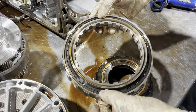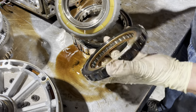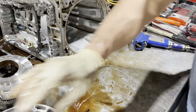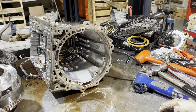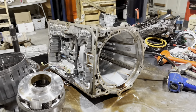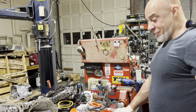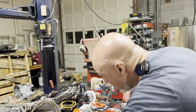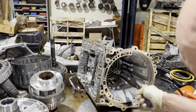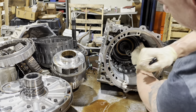This is your clutch drum - in here you're going to have a piston with O-rings, and as you can see there's a spring in here that acts as your return spring. And look - yet another sprag. We have plenty of them in here, but luckily they're pretty reliable in these things. A lot of transmission sprags are a source of problems and failures - by nature it's a little tiny part that works by wedging together and locking your 500 to 700 horsepower when a clutch pack applies. In some extreme applications they just roll over, but typically that's not an issue in here.